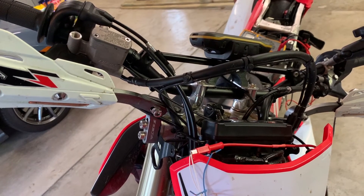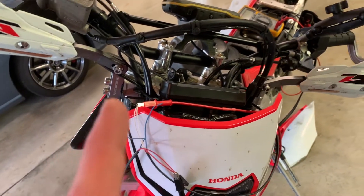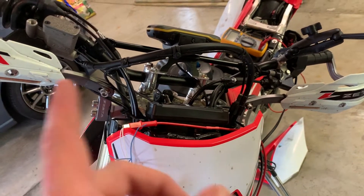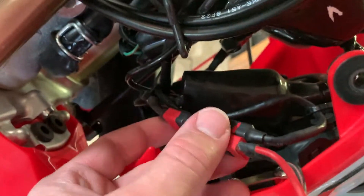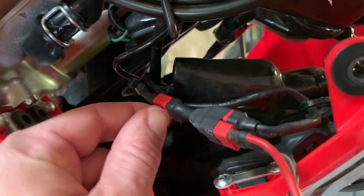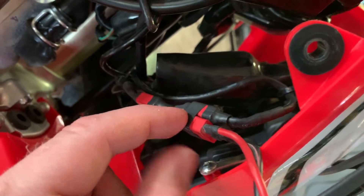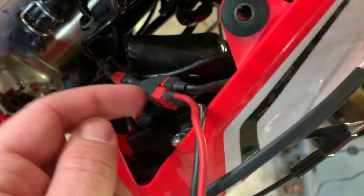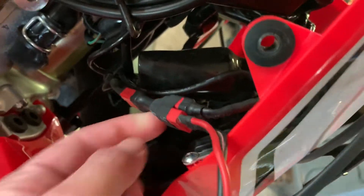Although I might just be trying to solve a problem that's not really going to be a problem once I'm on a bike ride. So I'm going to go ahead and wire it as recommended, with both switched for low and both switched for high. I settled on making a Y adapter with Dean's connectors — a single male on one end and two female on the other end — so I can still plug my GPS in and the heated grips plug into the other.